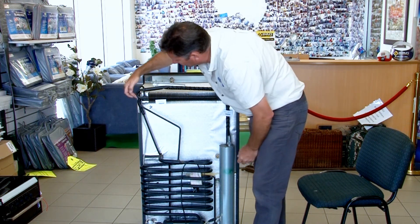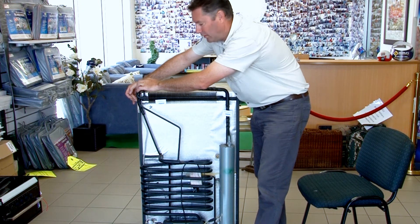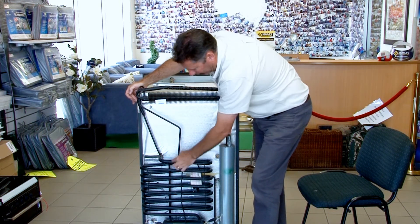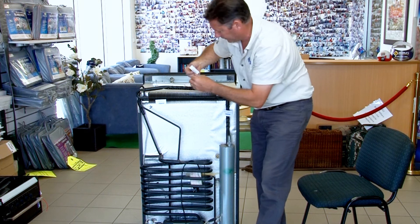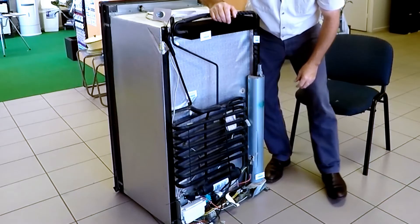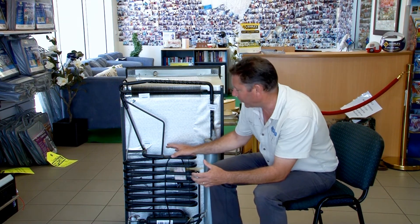The liquid ammonia then goes through and comes out here. There's another little tube for any excess ammonia vapours that will flow back in. The ammonia liquid goes into here and into the back of your fridge — into what's called the evaporator. That's actually in your cool box. The ammonia then mixes with the hydrogen and removes any heat from your cool box.